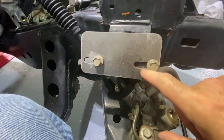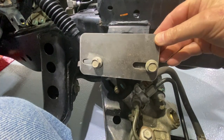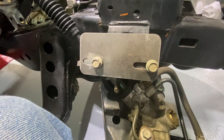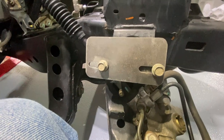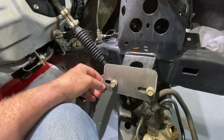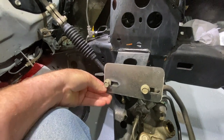There's a 1.25-inch slot on either side that will allow some movement front and back. We also have the sliding plates on the motor itself. So between the two plates and the amount of adjustability they have, we should be able to fine-tune the placement of the engine against the firewall, the transmission shifter within the hole, and the amount of space we need in the front between the radiator and the front of the engine.